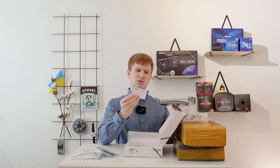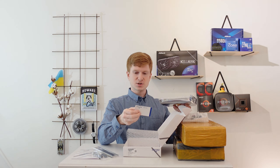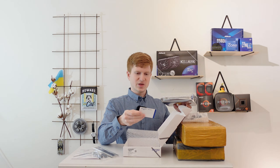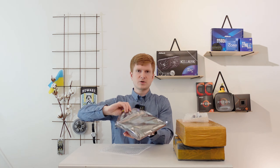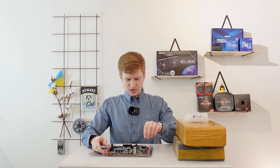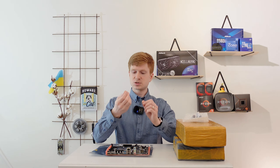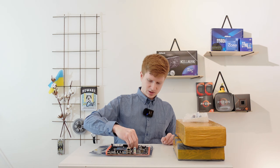So the motherboard itself. We have two installation tip cards. One says: when you receive the parcel, please first buy a CR2032 battery in your local store and install on your motherboard, then you can start using it. In reality the motherboard will work without the extra battery - it just will not save the BIOS settings if you power it off. They have a warranty protection sticker which I'm obviously going to break. And here comes the motherboard itself. I can see the M.2 SSD standoff is just flying around and not attached to anything, which is bad. I'll just screw it in so it doesn't damage anything.